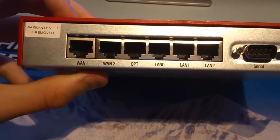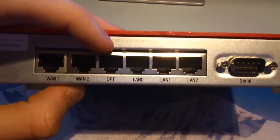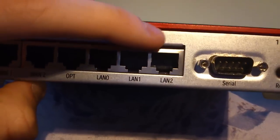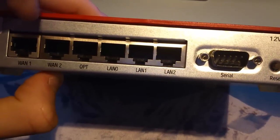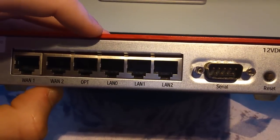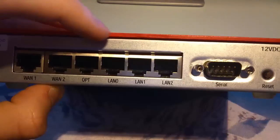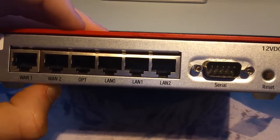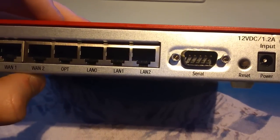It's not really a router as such — that's what I really like about this firewall. Then we've got an OPT port; I've only got one, but that doesn't make a huge difference because we can plug this into a switch and have lots of connections. Then we have our three LAN ports — our local area network ports. Now, my LAN runs on gigabit, or I force everyone in the house to use gigabit LAN. When I'm streaming movies from my desktop to my TV downstairs, I can stream things at a fast rate without buffering. So, gigabit switch going into 100 megabit LAN to give me internet access, and to do the NAT stuff and the VPN stuff.